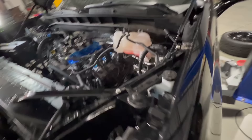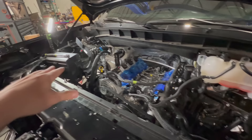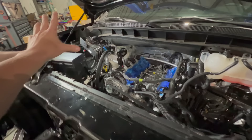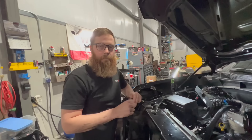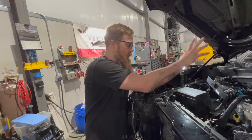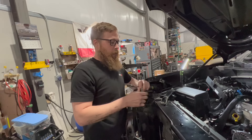Then we have the 2024 GMC over here. Cam's working on the turbo kit build. We already have one turbo mounted down low but the other side is tight on room, and by the time we add the scavenge pump, the tank, and the oil drain everything is going to be too low. So we're going to relocate the battery, relocate some stuff, and put the turbos up top where we have plenty of room. That way we don't need a scavenge pump and the exhaust routing will work just like we originally planned.